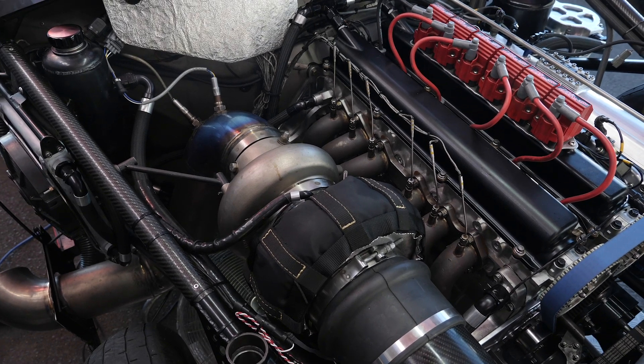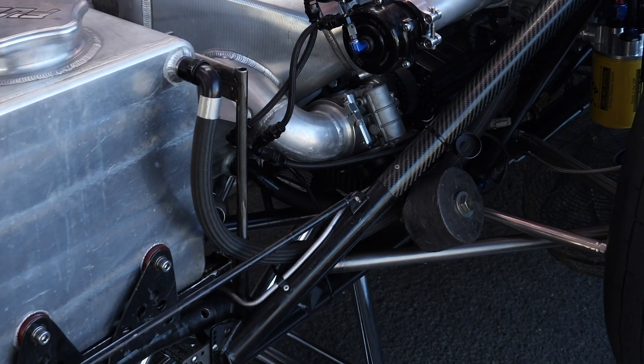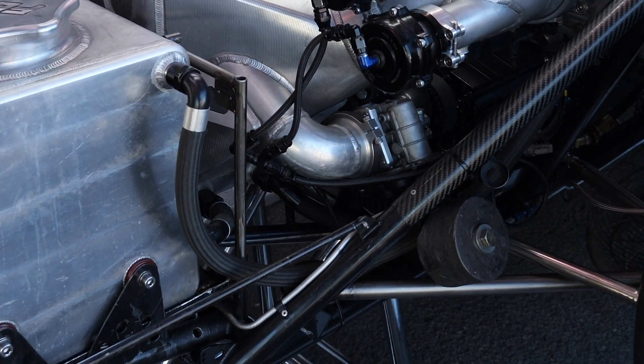Now that's how it's conventionally done, however Rod Harvey's gone about this in a completely different way. As we can see, there's no wastegate on the exhaust manifold anywhere to be seen. Instead, the boost control is done via a very small drive-by-wire throttle body that's fitted on the outlet of the intercooler.